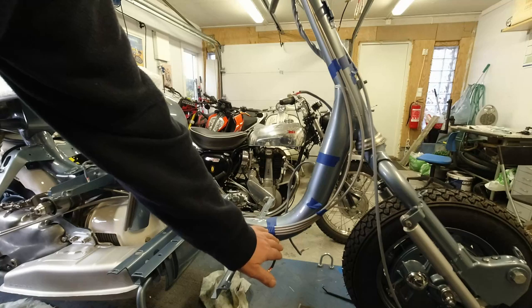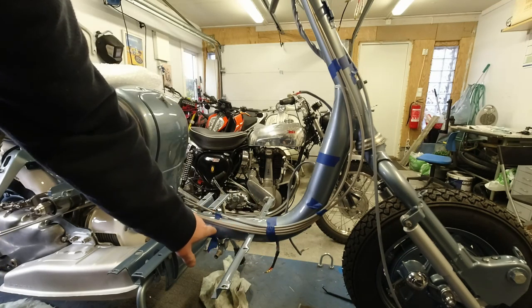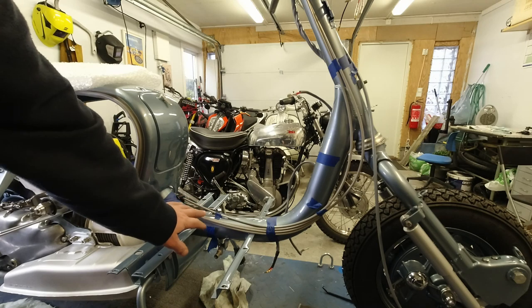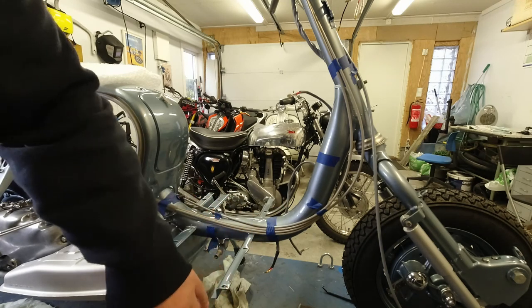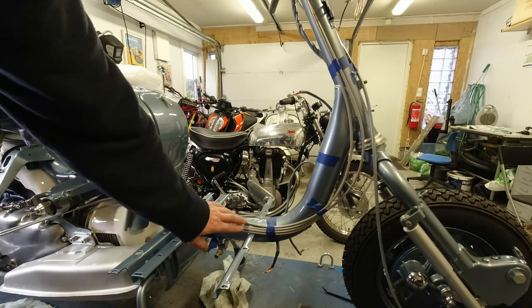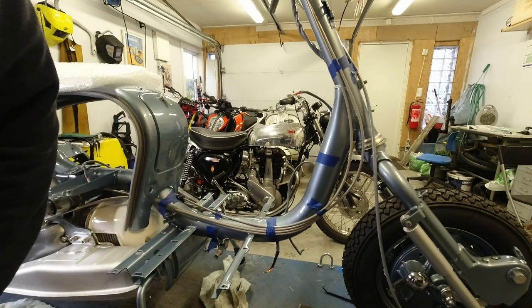Also, when I put the cables permanently into place, I actually just use black cable ties. The reason for that is that if we need to change an outer at a later date, then you can just jump under the scooter and cut it off, and then you can thread another zip tie around the frame to secure the cables again.